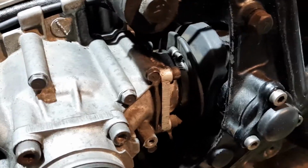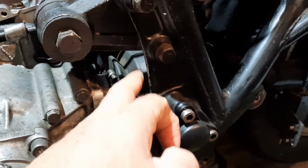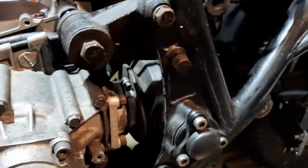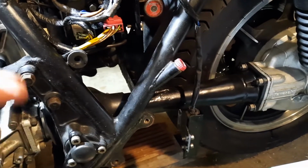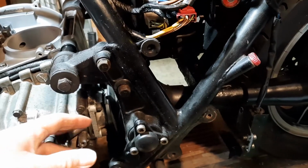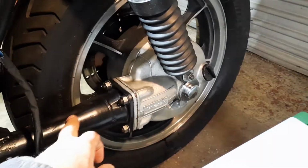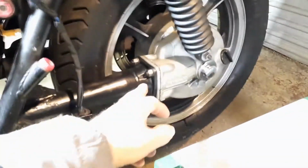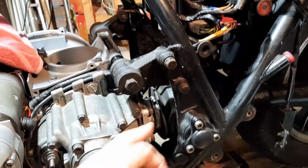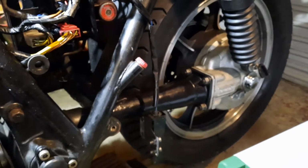Right, I wanted to talk about the drive shaft. I forgot to mention a couple of times on the last ones. Refer to my video earlier. I mentioned there's a pin which protrudes from the hole in the cup on the drive shaft. Now that drive shaft, I found, and this is just what I found, I'm not saying this is the way to do it, because maybe people will do it different ways, but what I found was that if you don't take the diff off and release the spring which is in there, which pushes on the floating splined slider joint, the drive joint from the prop shaft to the output gear on the diff, then the spring holds it up against this end here. So you can be there pushing that little pin in, and effectively what you're doing is you're trying to push the drive shaft that way, and the spring inside here is making it very hard. And believe you me, it is a strong spring. It's a very strong spring.